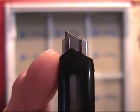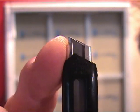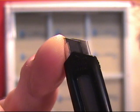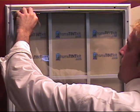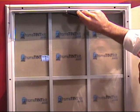When using the trimming knife, you want just one eighth of an inch sticking past the guard itself. What you're going to do is use the guard to push the film against the frame itself, then tilt the knife into the film to make your cut. Let me show you — push the film against the frame, tilt it, and make your cut. It's really easy.